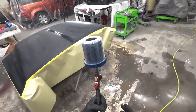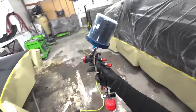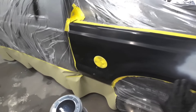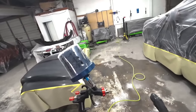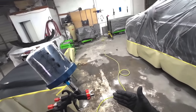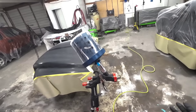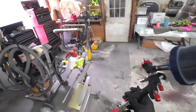Now we're set. As far as air pressure, I like it around 15 to 20 PSI — we're at 25, so there's 20, and that's perfect. Nice fan pattern. Before we spray, I'm going to tack this off because I've got just a little bit of dust from the sealer. There are very few things you have to worry about with your base coat. Unless you get into high metallic finishes, you want to use less air pressure and you want a wetter finish on your base coat — maybe not the first pass, but after that. This helps eliminate mottling or metallics laying funny in your base coat.